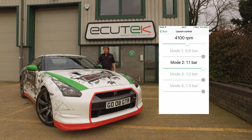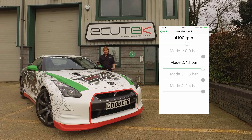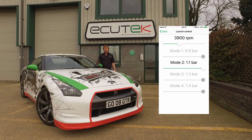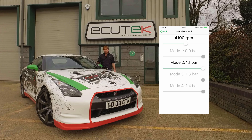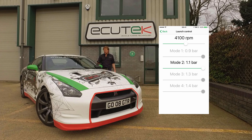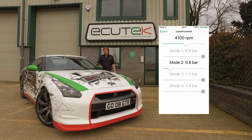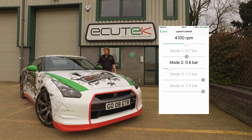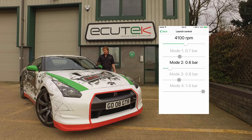Launch control — with the Nissan GTR we've got adjustable launch control. This combines the standard Nissan launch control with RaceROM launch control. RaceROM allows us to adjust the launch RPM live using our phone. We also have boost off the line, and depending on which map mode is selected, that determines the target boost pressure. You can see mode two is highlighted, and we can reduce or increase the target boost pressure for conditions at the track. We've got a different boost off the line target for each map switch mode.